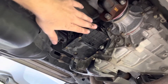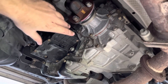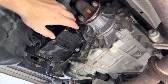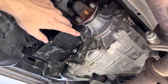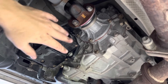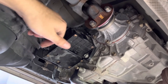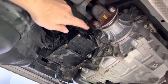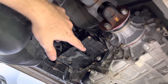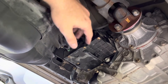Putting this back on — it went on a lot smoother than I expected. Just gently rocking it and eventually getting it in place. That actually popped the spring out of the new seal we installed, so I put it back — I can see why they send an extra. Once you get it in there, make sure you connect your vacuum line first before you do anything. I cut the end off of mine and put some electrical tape on it. Slide it on nice and easy, get all three bolts started and tighten them down — not too tight — then connect the electrical.